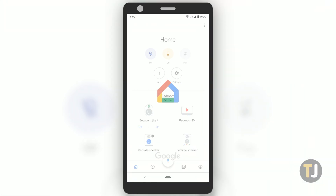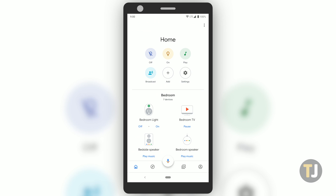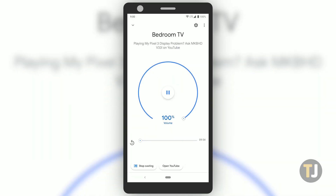With all this out of the way, dive into the Google Home app on your phone. While something is casting on your device, select the Chromecast device from the main screen in Google Home and you'll get a basic remote interface. The circular interface here is the volume slider. You'll need to ensure that the slider is turned up in order to control your Chromecast volume. It's really easy to accidentally mute your Chromecast without realizing it, so definitely check your volume settings.